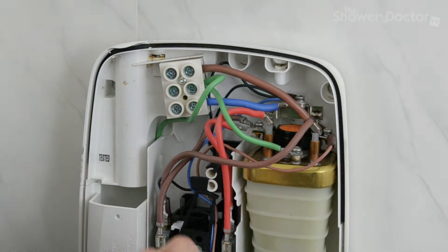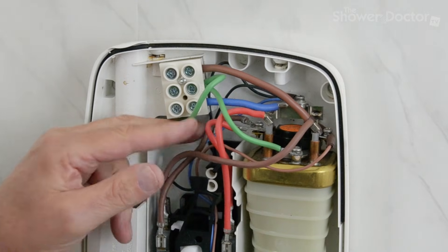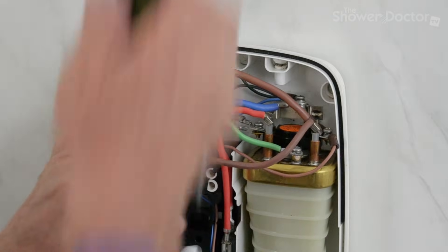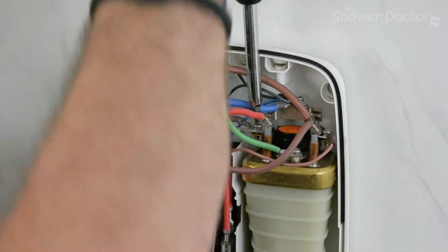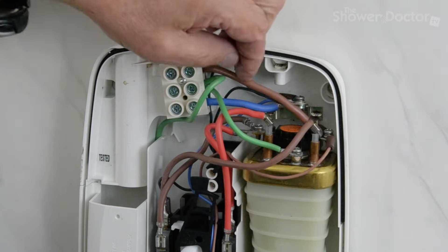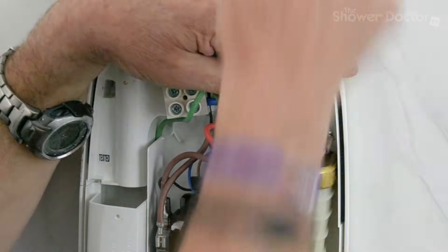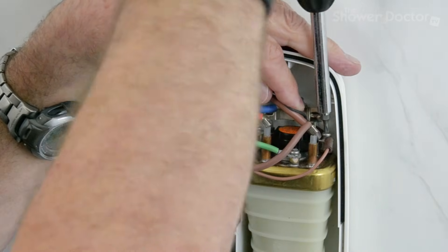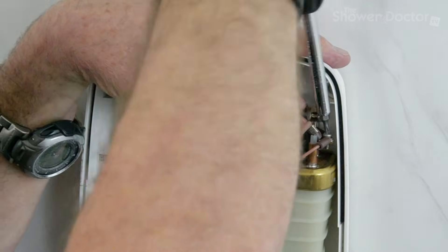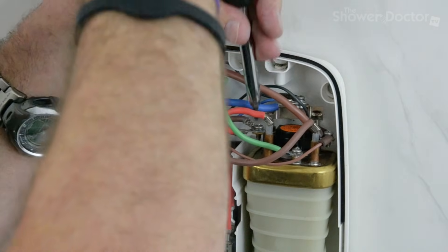Here's one of the really important bits: the wires are all crammed in here very tightly, so when you're tightening the connections back up to the thermal cutout, make sure you haven't got them pushed against one of the rods that come out of the heating tank — make sure they're all clear of everything. This side is fairly easy, just tightening it up. This side is much more difficult because the wires are so close to each other. Get them to the stage where they're not quite tight and you can move them so they won't spring anywhere. Then tighten the earth down and go back over to make sure everything's tight.